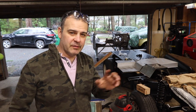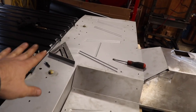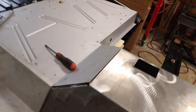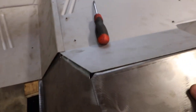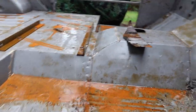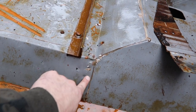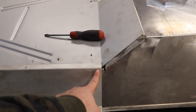So it's been a couple hours and I just want to show you some of the challenges I'm having. I've got the floor sort of clecoed in, bolted down on one side, and the front cross brace in and bolted down to my bushings. I'm trying to get this tunnel fit right — when I get it flush on that side there's quite a gap on the other side. I went and looked at the original body and you can see they cut this lip and bent it in to meet up with the tunnel, so I'm thinking I have to do the same thing here.